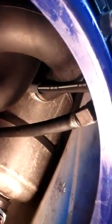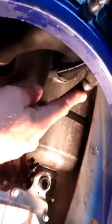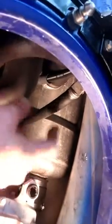That is essential. If I didn't have that on, this ski would have sunk. This is part of the, it goes down to that little box down there. And when you're riding, the jet pump actually sucks water out from the hull through that, up through this. And that's the only thing that saved this ski. This does not have an electric pump like the higher end models. This is just a cheap, price point ski from the time, and it does not have an electronic pump. It just has that little gray box down there that attaches to that tube, and it's a suction pump. And it works off the jet drive. I'll probably show you how that works.